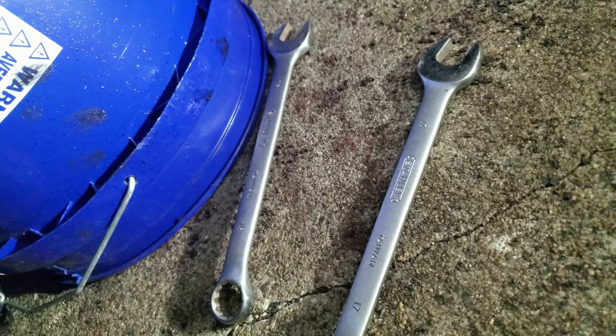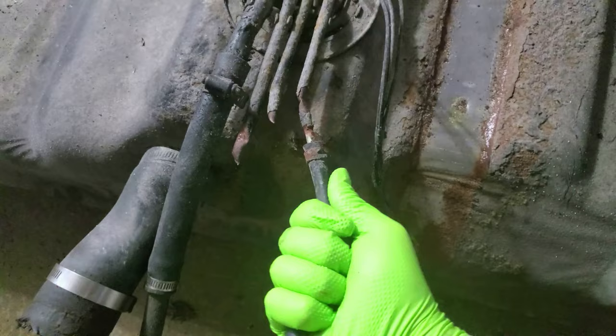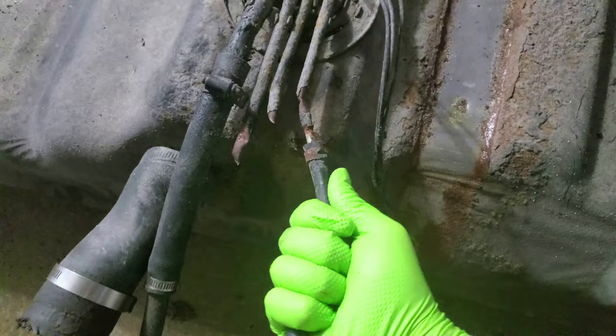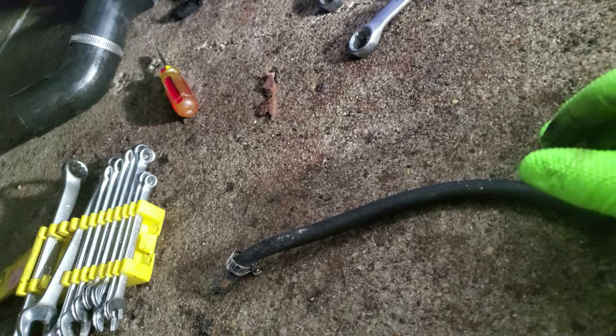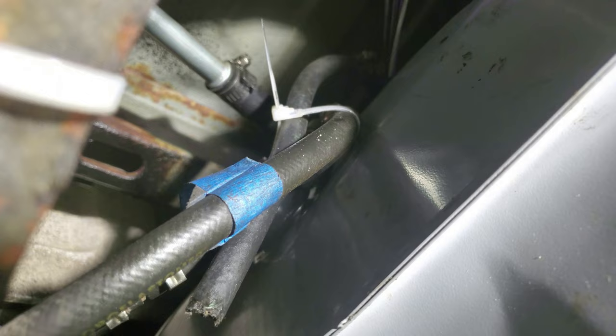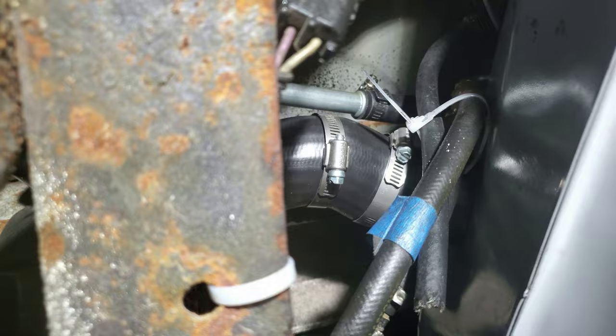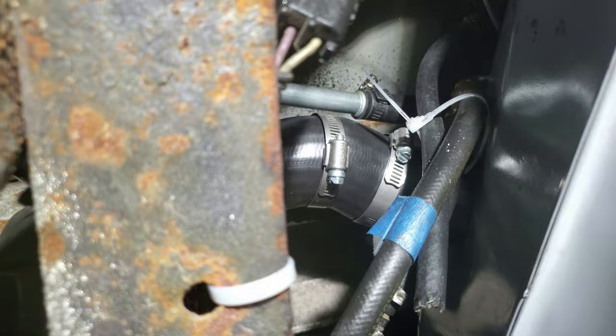The fourth line is just a vent line. I pulled the old one off, cut the corroded tip, and added a clamp. I also positioned the fuel line above the bracket and zip-tied it, then zip-tied the fuel lines and vent hose together. The fuel fill line is attached, though there are quite a few bends and a significant angle to get up and outside of the step side bed — it's complicated with a lot of messing around.